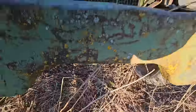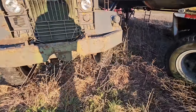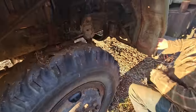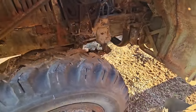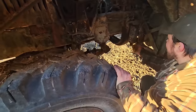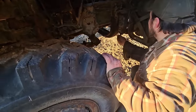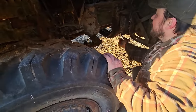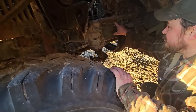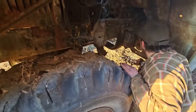So we might as well just plan on doing a boat tank and everything, that eliminates a lot of the issues. That was my plan to begin with. You could definitely plug a carburetor up. I just hit the drain on this filter and nothing coming out. These lines look really, really rough. It looks like they replaced the lift pump. They probably were still having trouble, and that's why he told me the lines had holes. Yeah, it looks rough. We'll eliminate all that.